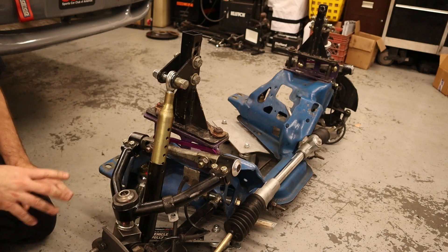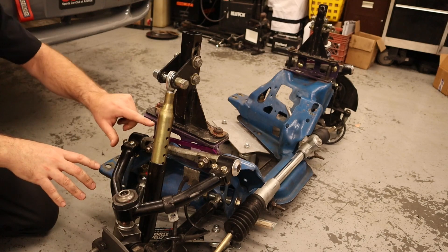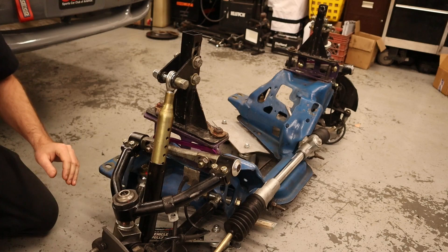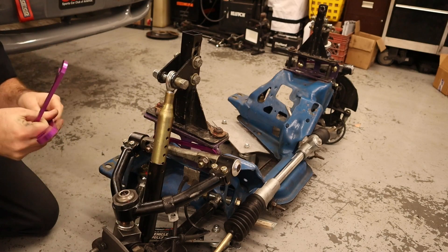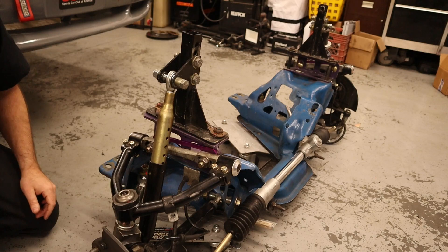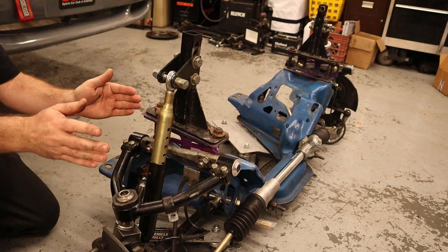For adjustments like alignment and camber, there's basically a shim plate that goes in here to move the upper arm in and out. These shims come in multiple different sizes that slip right in there. You can see that I have a 3/16th one in there right now — there are also 3/8 and 3/4 inch ones and some smaller ones that will move the upper part of the suspension in and out.